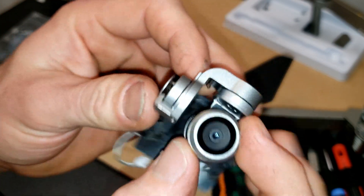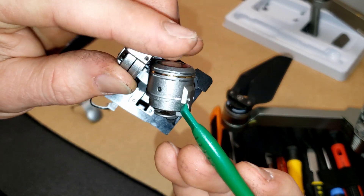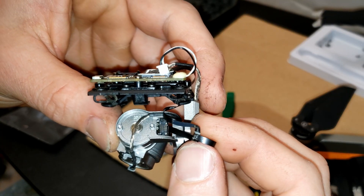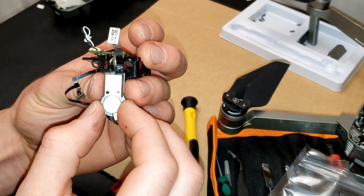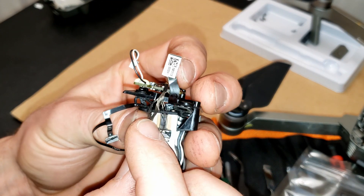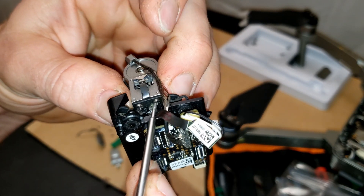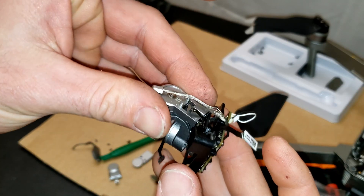Now it wraps over and goes down, so it looks like we've got to take the back cover off from the camera — two Phillips. Same thing under there: pry that connector up, being careful with the silicone on there. Then you pull the cable all off and feed it through the holes. It starts by going through this slot. You do have to remove the third cover with two Phillips screws on it, and there's one more connector down there with a piece of tape over it. With that tape off, you also remove these two Phillips screws because the cable goes under that — removing this little plastic bridge, which is basically all that holds the gimbal to the frame.